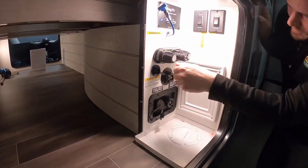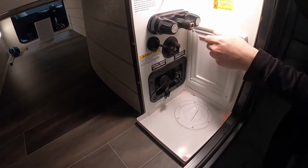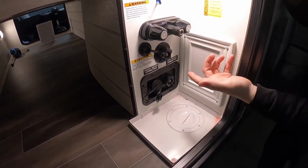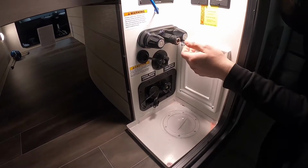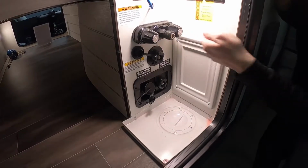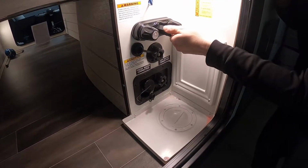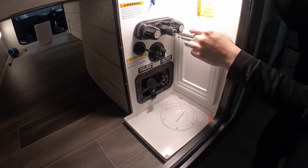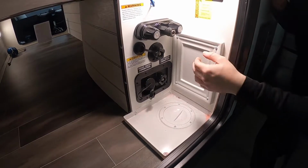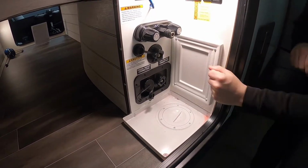From there you have an outside shower, which is simple. Now I've gotten called quite a few times, with people saying that these don't work. There's a blue coil hose that's in the unit, and these have been on every unit for a long time. There used to be a sticker around this that said if you can't physically push in the nozzle that goes in here, because it's really stiff, you can take a slightly bigger Phillips head screwdriver, or a punch if you have a big punch, stick it in there and give it a slight whack with a hammer.